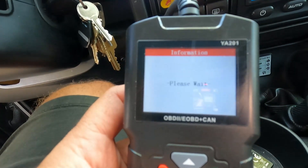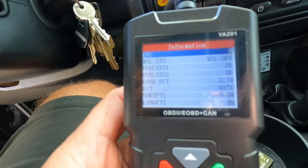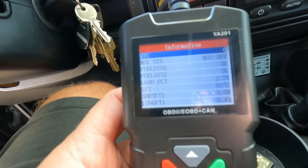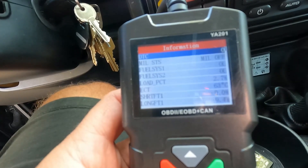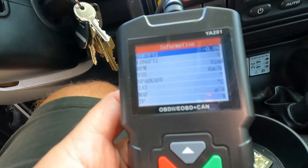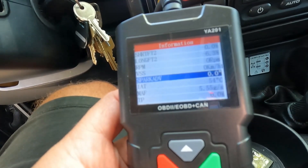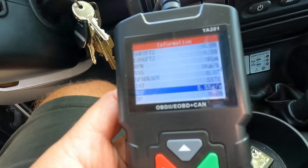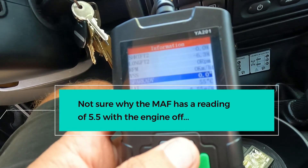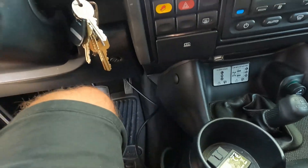This also has a nice feature for live data. Press and hold the OK button for all the information — and there you go. You can go through here: it's showing diagnostic trouble codes — none shown — malfunction indicator lamp is off, fuel system codes, long and short term fuel trims, RPMs, vehicle speed, spark advance, intake air temperature, mass airflow sensor. Let's turn the vehicle on while we have this plugged in and verify a few of these.